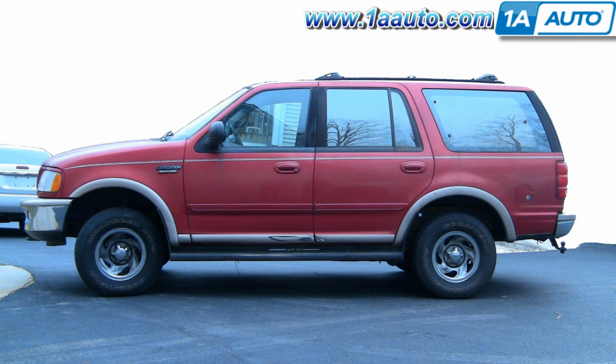In this video, I'm going to show you how to replace the stabilizer links on this 97 Expedition. Same as many Ford and Lincoln trucks and SUVs. And when these go bad, sometimes they break outright and just kind of fall out. Then your truck's going to sway back and forth more. Also, you may hear a clunking when you go over bumps, and then that clunking actually goes away when you're going over bumps but you're turning, because it's putting some pressure on the link and not making noise.